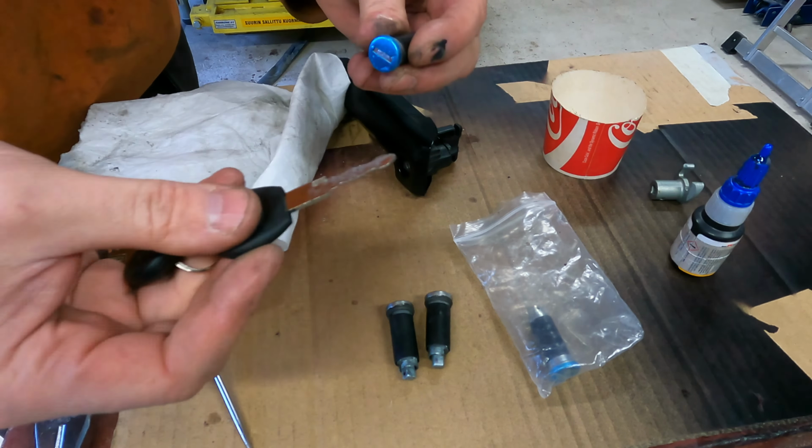You can add it later also, but now it's easy to put a little bit extra here. I use this kind of PTFE spray. You can use this with plastic, metal and plastic parts. And then we put the barrel in the hole, and you will see the slots here. This slot is for the spring, so you cannot put it in the wrong way.